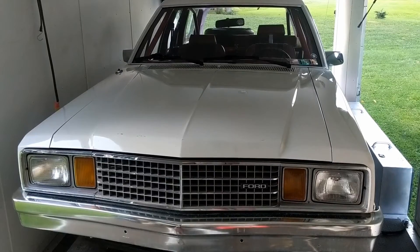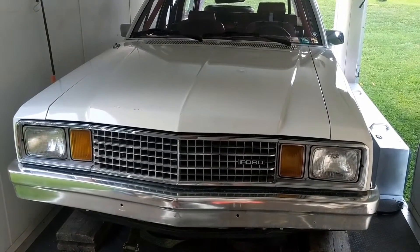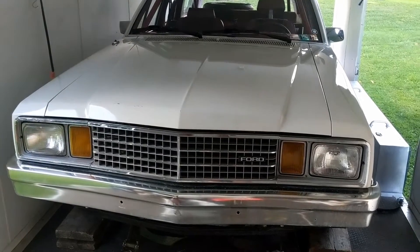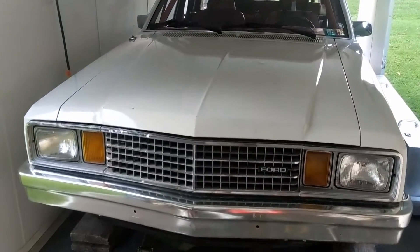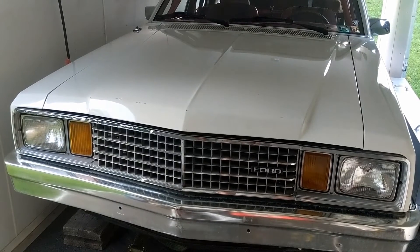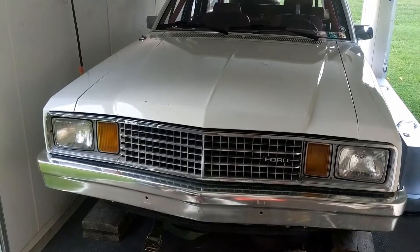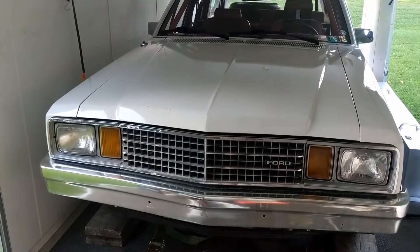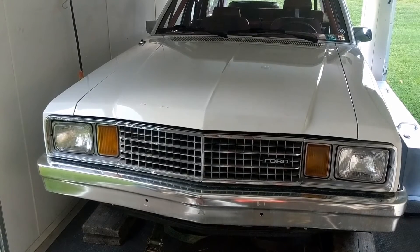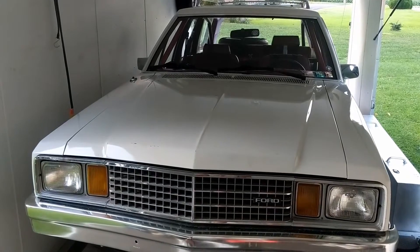I had tried to turn up the boost but it basically wouldn't go any higher. I think it was the same issue we were seeing at the dyno. For whatever reason, the closed loop on the Holley didn't want to go above a 90% duty cycle. I don't know if they... I mean, most solenoids don't typically make a big difference at greater than 90%, but for whatever reason our four-port solenoid made a huge difference.